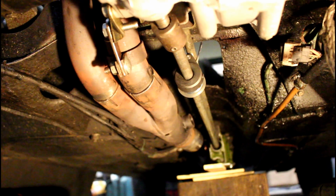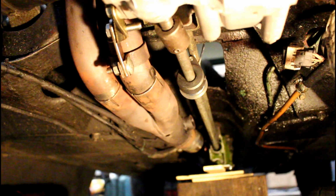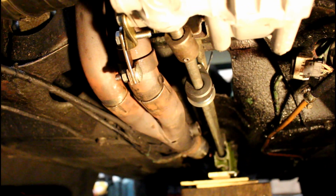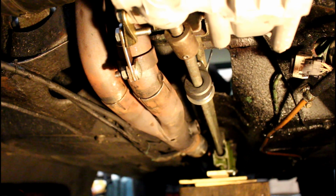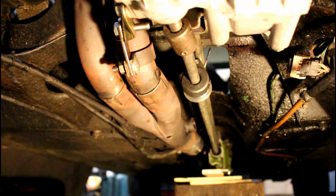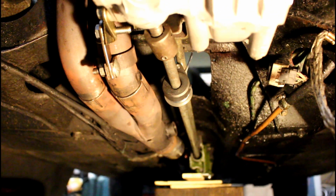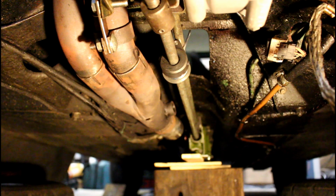The exhaust is going to need a total refabrication, because it was custom, because it never did fit straight from the factory, or the manifold factory. So it was all altered to suit the car. Now it's going to need altering again. And you can see the lambda boss there is right where the rods are for the gear change. Even though that gear change needs to go up quite a bit into the well, what are you going to call it, the exhaust tunnel.